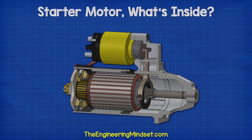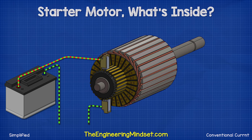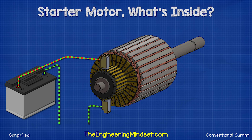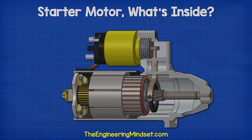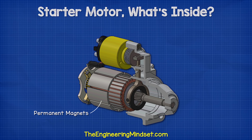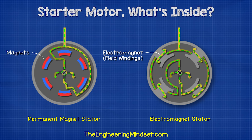At the end of the motor, we find some spring-loaded brushes, which push against the commutator plates. These will slide across the commutator plates and allow electricity to flow through the coils of wire in the rotor. Surrounding the rotor and attached to the case are some permanent magnets — these form the stator. Some models of starter motor will use field windings, which are simply coils of wire that, when powered, will generate an electromagnetic field. These essentially do the same job, just with a slightly more complex design, which can generally produce a more powerful magnetic field.